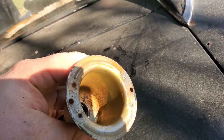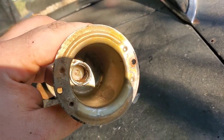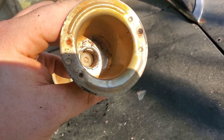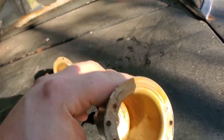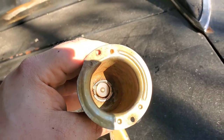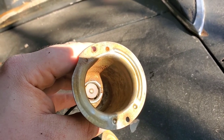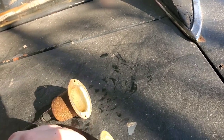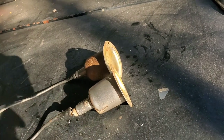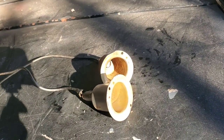All it was is vinegar, and this one cleaned up very nice. The bottom contact spring on the other one is not springing back, so I'm not sure how much contact the bulb is going to have — I'm hoping it'll be fine. The other socket is springing up like it should. Let me get some paint on these, let them dry, and then I'll get them on the truck with the custom 3D printed reverse lenses.